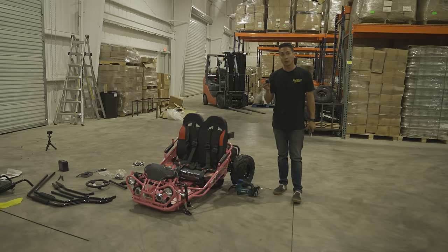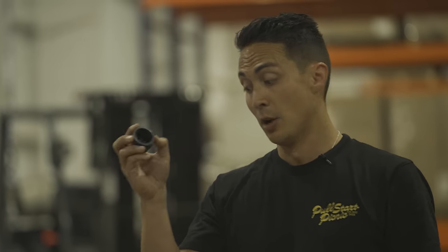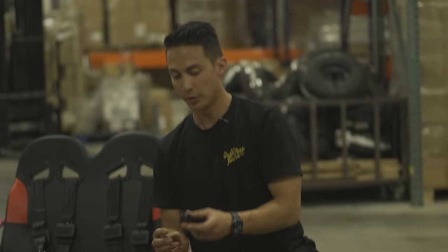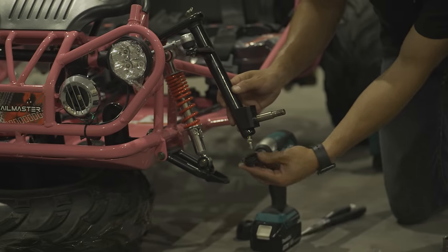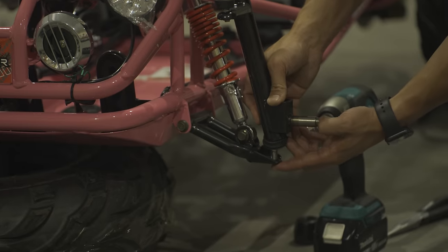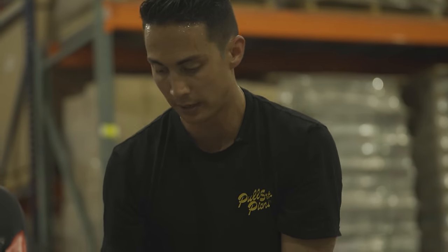After you've tightened down your axle bolt and put your cotter pin through, these rubberized hubs will fit over your axle. With this front spindle, you're going to see a little rubberized boot — this boot goes on the bottom bolt of your spindle. Put that rubberized boot onto the bottom of your spindle bolt, feed your spindle bolt through the lower A-arm, then your washer and 17mm castle nut to tighten it down.